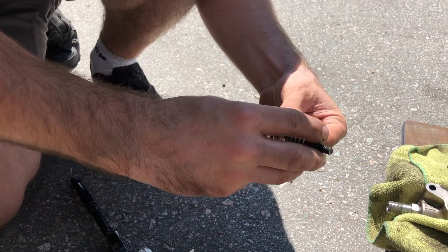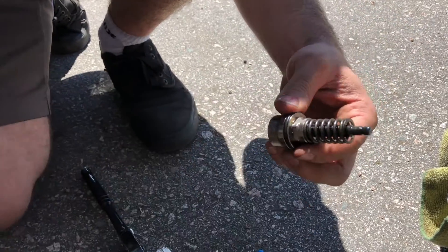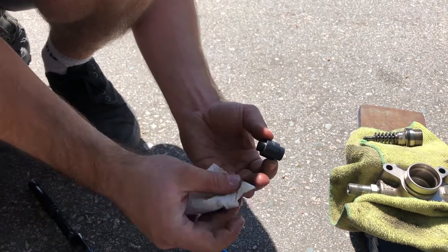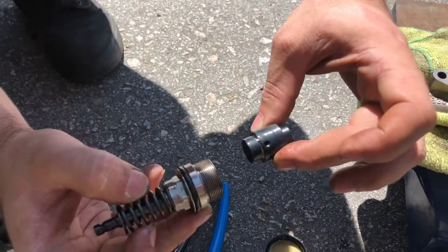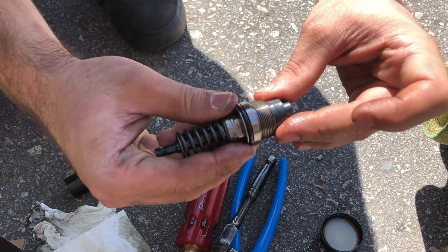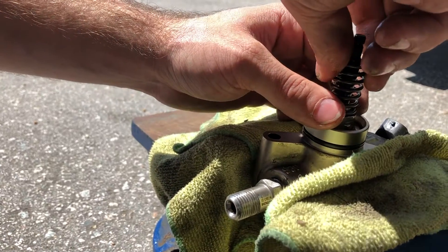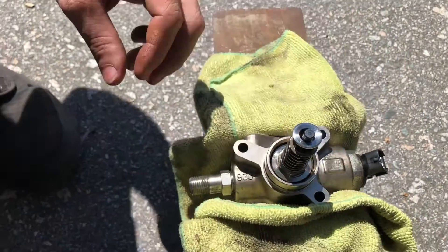We popped the keepers off the top because they're installed from the factory. Pull down the top retaining ring and they just come out. We lubed up the shaft with some oil, now we're going to stick it in like so — nice and gentle. It should go fairly easily on its own. A little twist and she is in. Now put that spring back on, then set it down on a clean rag and lube up this guy as well.